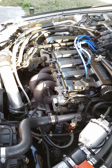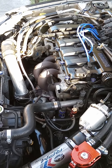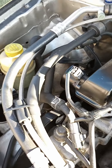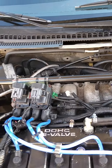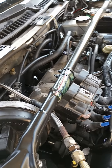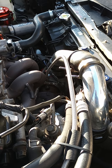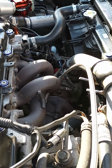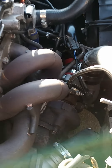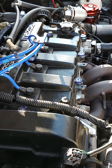I can't really get under the car with the phone right now, but I tapped my oil pan as high up as possible for the turbo drain line. My turbo feed line, which you can see goes all the way around the back there — I teed off of where my oil pressure switch is with an oil feed line kit off eBay. The only trouble I had was finding the correct fitting for the oil feed on top of the turbo, but a hose and fitting shop eventually got me hooked up. I honestly don't remember the thread pitch and size.